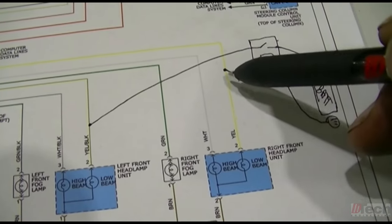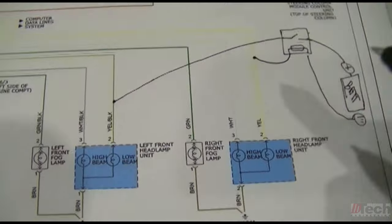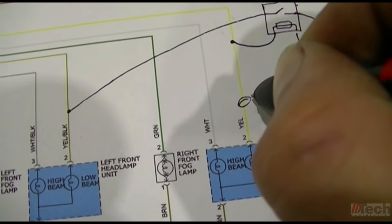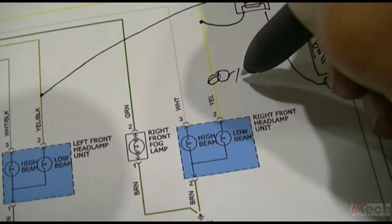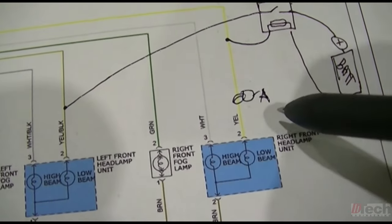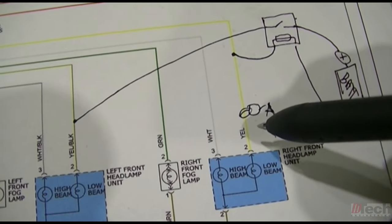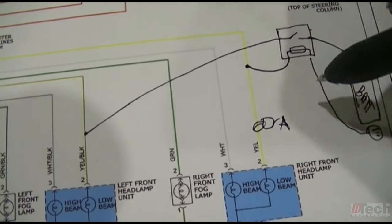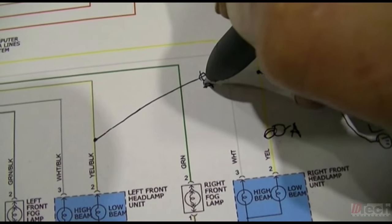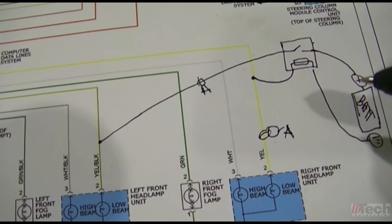My idea was, again, to use this, since this will not draw too much amperage, and see if it'll turn it on and leave it on and have everything be okay. What I'm going to do to monitor this, first I am going to amp clamp here and check what the amperage is before doing any of this. That way I have a known good single bulb operating amperage measurement before doing anything. Then I will still monitor that when having this hooked up, and also put an amp clamp here and monitor that draw as well, just to compare and make sure everything is kosher.